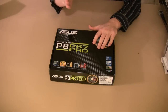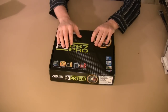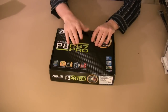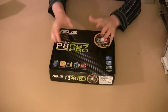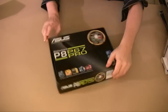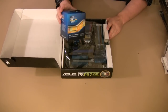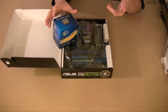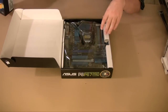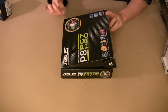Once you've got those three — a motherboard, a CPU, and RAM that works together — after that it gets a lot easier. Most video cards follow the same socket standard now, and hard drives are all going to be the same. That's really the core of it. Interestingly, these motherboards actually came out before the Sandy Bridge chips, despite the fact that they only work with Sandy Bridge. So you could have gotten one of these up to a month ago. We're going with an Asus P8 P67 Pro Series motherboard.